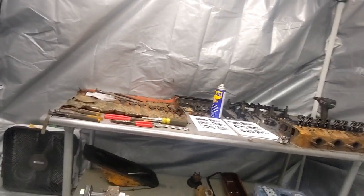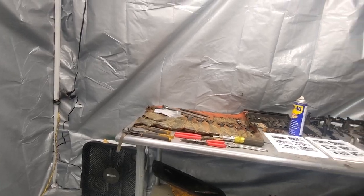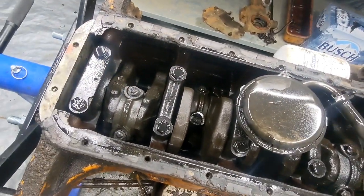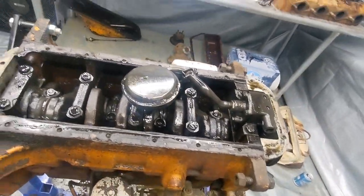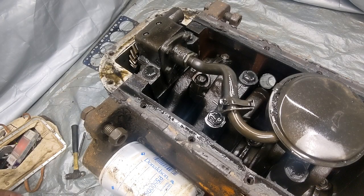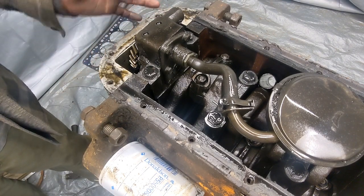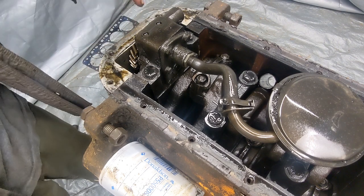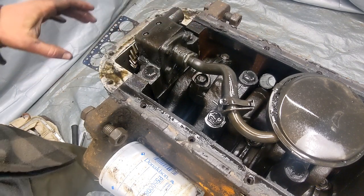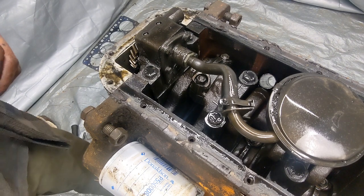This right here is the actual crankshaft, so I don't want to beat on that - risk breaking it. Those are cast parts typically and they can be brittle. What I am going to do is pull apart some bearings in here - I want to look at them. The next step is to get the oil pump off, which is the front main bearing cap. We're going to go ahead and pull this oil pump off and we'll be able to look at the front main bearings and see what's going on.